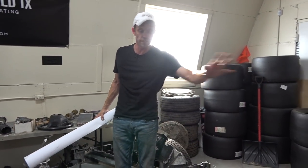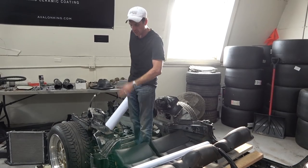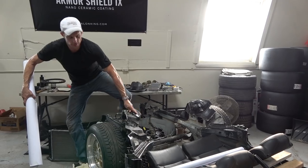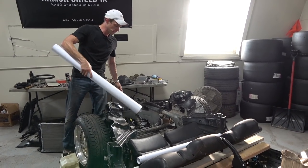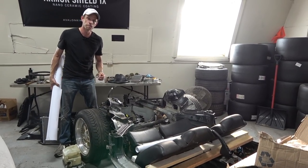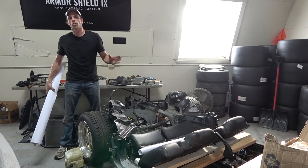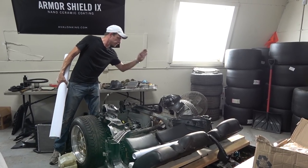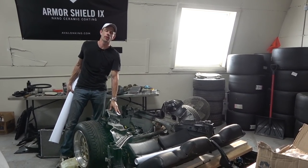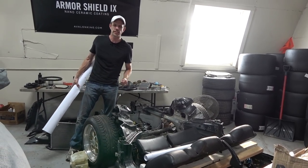That's because the structural integrity is gone. But I don't really care, because right now I just want this to all hold together. Lots of this is gonna be cut away, reconfigured, steel welded in place. For everybody saying I should be putting in a chassis jig — no, I don't. Because what's left of the chassis still holds the subframe and suspension in the exact place it used to be. The only thing that can change is this flexing ever so slightly, and I'll have adjustability in what we create with the top. So long story short: don't overthink it. This is still gonna be great — you can measure it and get everything square.